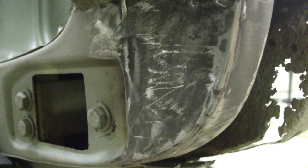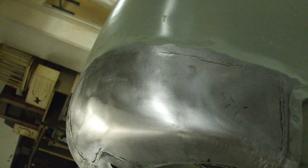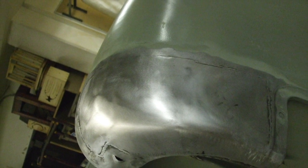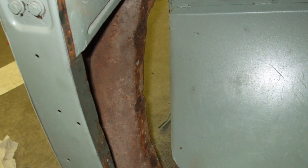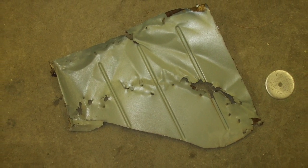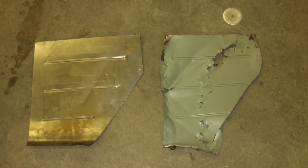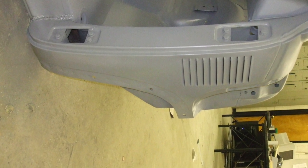The seat I had reupholstered, the factory seat. I was going to keep the bench in it. I made it column shift to keep the floor clean, and it had a 400 transmission in it, long tail shaft transmission. And the side panels here that you see, I actually made those. I made them from scratch with a bead roller and a shear and hammer and dolly.